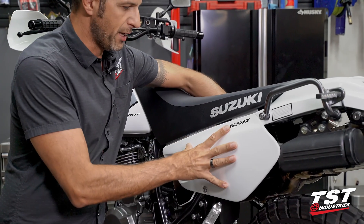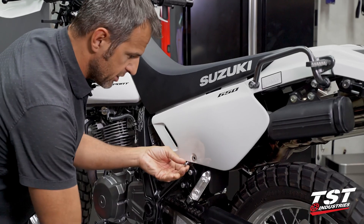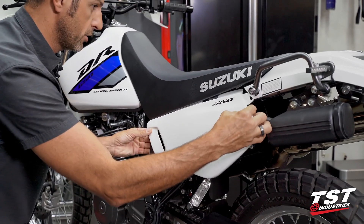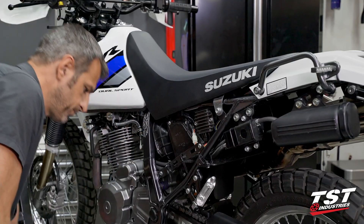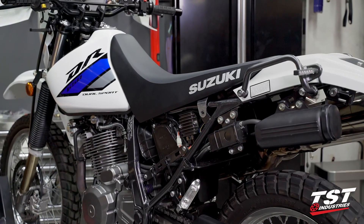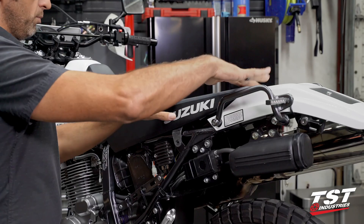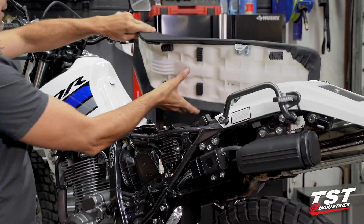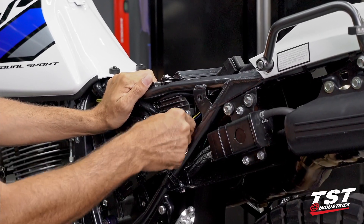In step one we will be removing the two plastic panels under the seat, and also the seat. Use a Phillips head tool to remove this fastener — it does have a tea washer on it, don't lose that. Once that fastener is out, push forward to clear the interference locks and the hole that accepts a peg in the front of the air box. Then use a 12 millimeter socket to remove the seat bolt and repeat the process on the other side. Once those fasteners are out, pull down and backwards to clear the interference locks and gain access to the wiring.